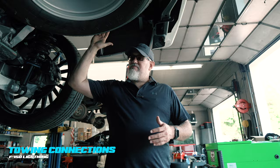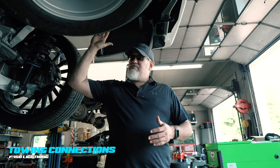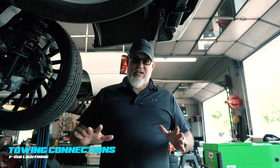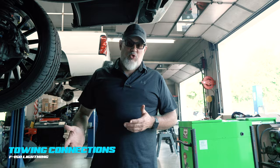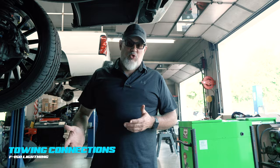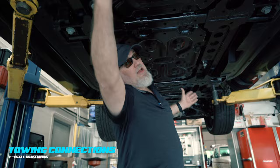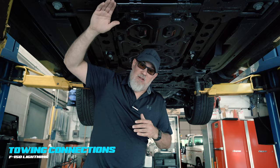It is a full-size tire — customer gets a flat, it's really easy to do a tire change. They have changed the rear suspension in this vehicle, going away from the live axle to an independent rear suspension. The control arms are aluminum. There's no more jacking this vehicle up by the rear end, by the axle, or by anything back there — you have to go on the dedicated jacking points. If you try to just toss a jack here you're going to damage the skid plate; if you try to jack by the control arms there will be tooling marks. The F-150 Lightning is still body-on-frame construction, and the battery lives inside the frame rails. We want to stay away from the battery entirely — don't get a jack inside the frame rails and inadvertently damage the battery or skid plates.